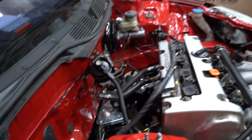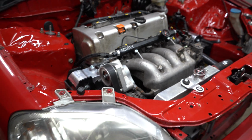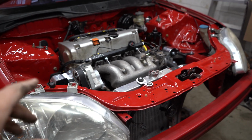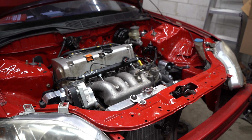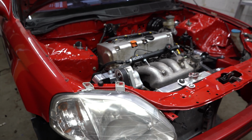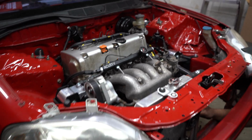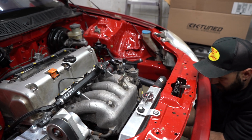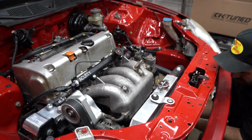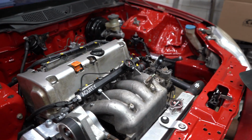But yeah, as you guys can see, everything is coming together. Super excited. I think I may go with the Jackson Racing kit. Try pushing around 280, 300 and keep a super sleeper, quiet exhaust. I think that's gonna be very, very fun for a little while. Maybe we'll change it in the future. It's pretty easy to switch up, because it's a manifold style, so there's no intercooler, just pulleys and the supercharger itself, which would replace that. That's an idea I have.